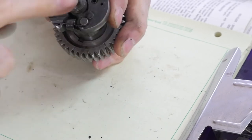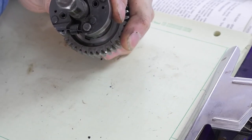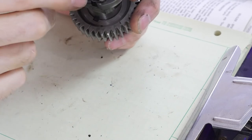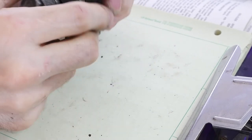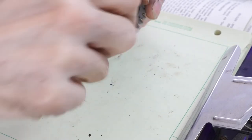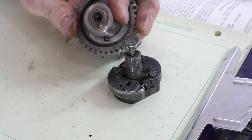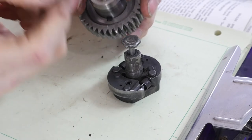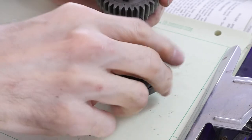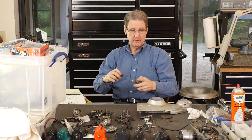The one time I had to push my bike is when this stud broke off. Thankfully I'm an anti-seize guy — Permatex anti-seize. So even though the bolt was broken off, pretty much inside this little thing, it broke in a little spiral. And I was able to take a screw extractor at JC's place in Reno and work it out. Once I got it out, we went to the Reno Harley dealer and they said, 'Boy, we sell a lot of those.' Why do they break? What snaps this bolt off? Let's show you.